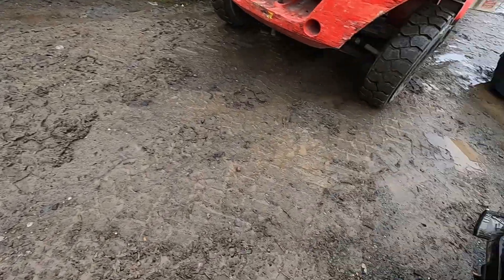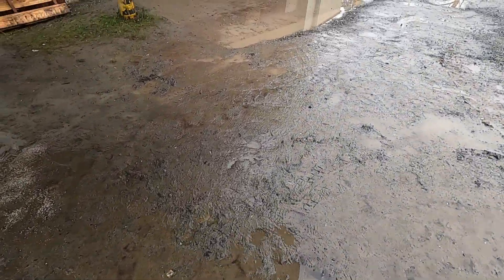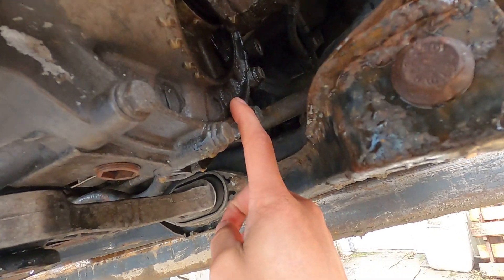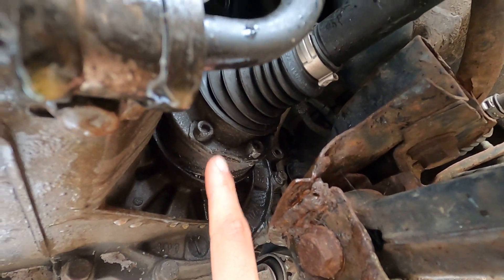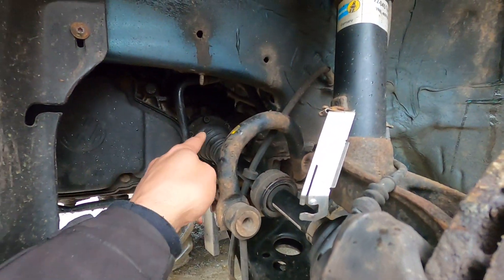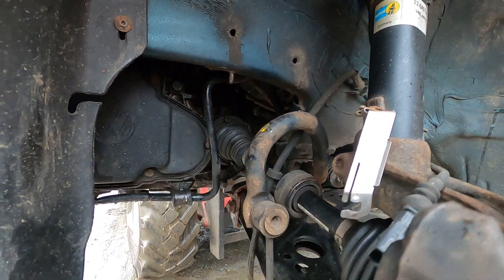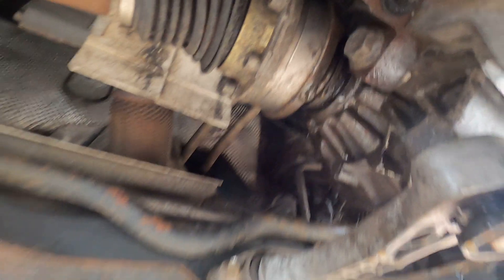After a little bit of maneuvering we now have the car up in the air. If we look right here on the bottom you can see where it says O2J right there on the trans, and you can also see these smaller axle bolts meaning the 100 millimeter flanges. So: axle bolts to the flange come off, axle nut comes off, pull the entire axle out, then it's like a five, six, or maybe bigger allen in the center, pop the whole flange out, repeat on this side, and then we're good to go.